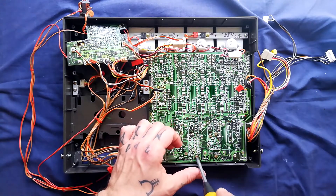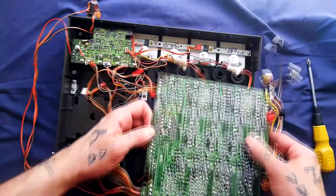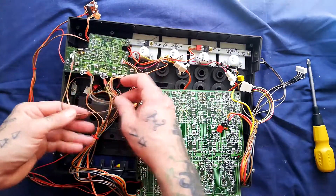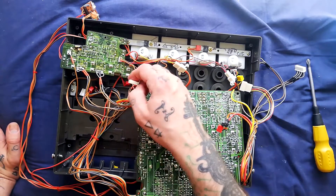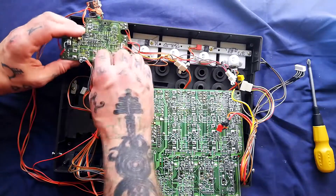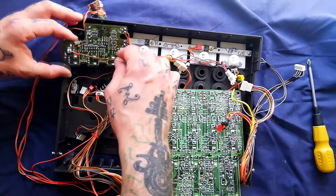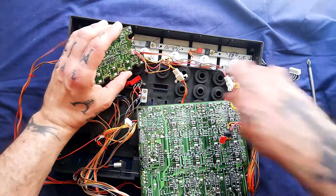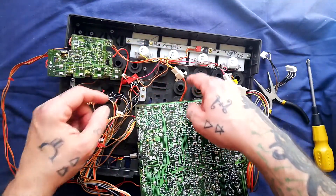We've got another three screws here, and then another cable tidy just below this header. With that removed, we can more clearly see that there are five headers going into this cue board. Four of them emerge from this corner of the mixer — four of them with four pins. Double check on your unit in case I've made a mistake reconstructing this. It looks like the multicoloured one is over here on the right, and the length of these two very similar looking cables gives you a clue about which goes where. The brown and grey ones are going into those two headers there, and this little two-pin one is going into a little header that's passing through a hole in the PCB. Then this remaining header is a little bit stiff — use metal pliers — and it runs over to these meters on the mixer board.